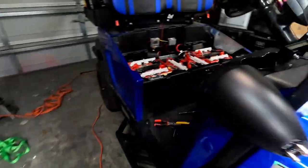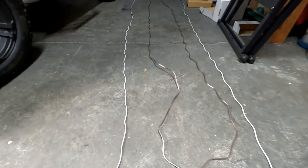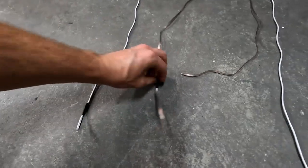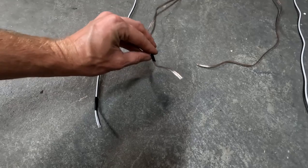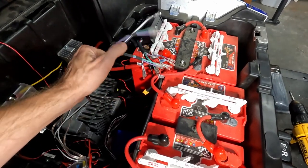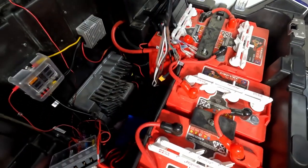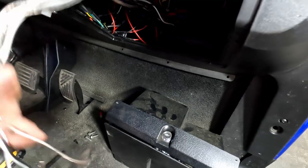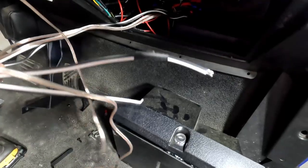Now I've got the passenger side on, and it's time to move on to the speaker wiring — the fun part. I have my four wires laid out, and I went ahead and marked which ones are going to be on the passenger side, the right channel. I'll probably use the bullet speakers on black and white, and then speaker wire for the kicker speakers. Now I've got all my wires run and separated for right and left sides with the tape. Couldn't find my wire loom, so I just taped it every foot or so as it was going down. I've gone ahead and got all these plugged into the correct spots, and now under the dash I've got all my wires pulled through here. I've got them taped, so I know which one's right and left.